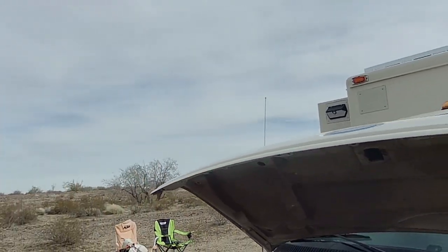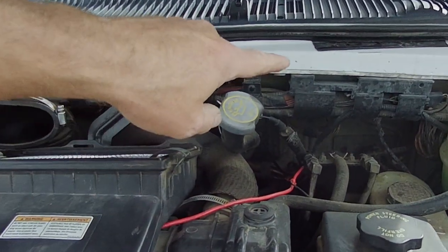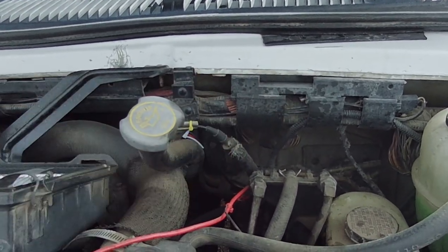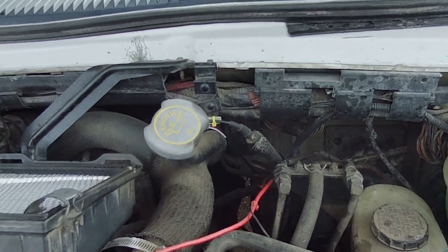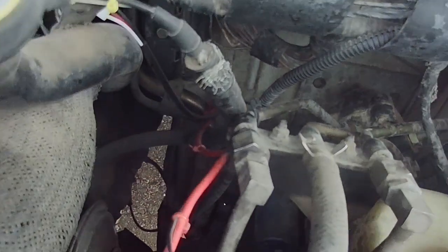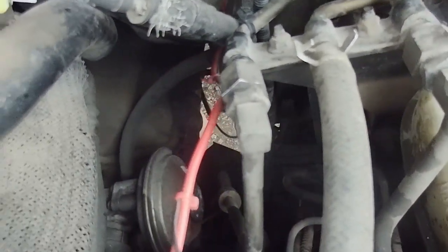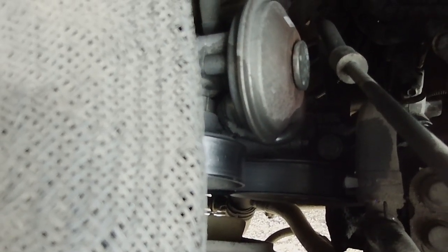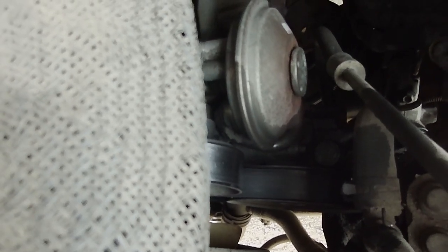Hey gang, so let's get a look under the hood here and see what I saw yesterday when I popped the hood after our trip up to Walmart. That's the first thing I saw when I opened the hood — these dots of spray fluid here, so I immediately knew there was an issue. You can see that there was fluid. Looking down at the pump down there, the pump itself is wet. The hose that comes out of the pump is wet, so I've got to guess that the pump itself is producing blow-by of fluid.